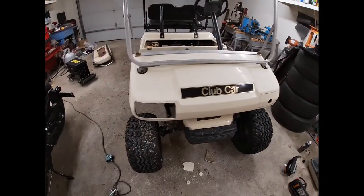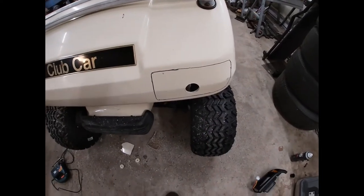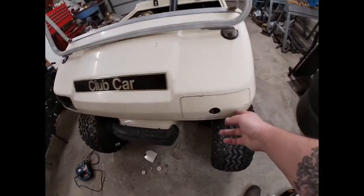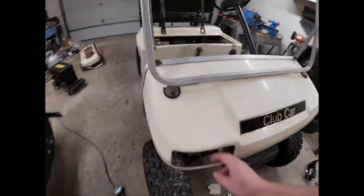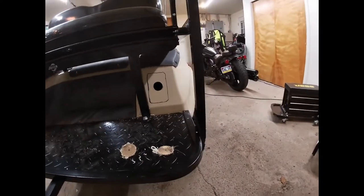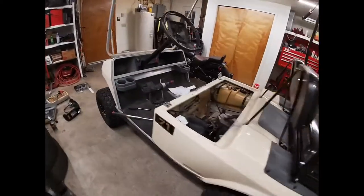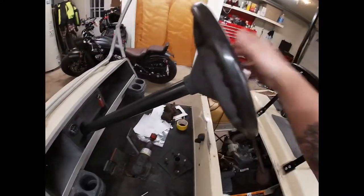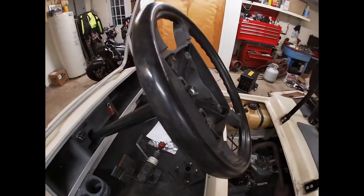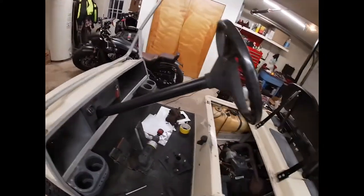We moved on to putting in the headlights and tail lights. I take a hole saw and then use a jigsaw to cut the body out — it cuts really nicely. They give you templates that match up to the body lines, so it's not too bad. I wish I'd done this before I put the rear seat on, but it is what it is. I also noticed a bushing in the steering column was bad, so I spun a new one on a lathe — from the factory they use nylon or Delrin. I made mine out of aluminum with a grease groove, so it's nice and tight. I just need to straighten the steering wheel out a little bit and we're good.